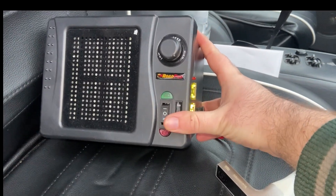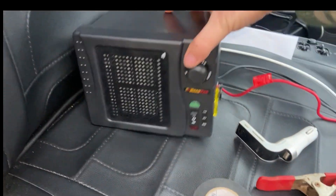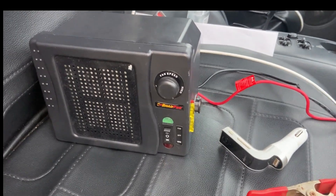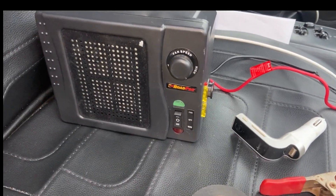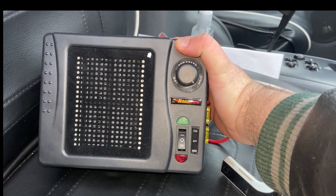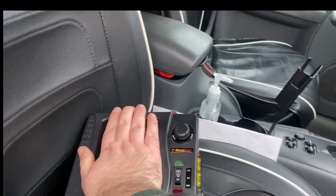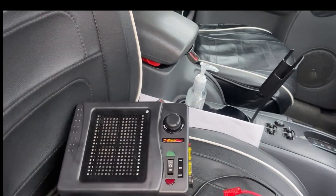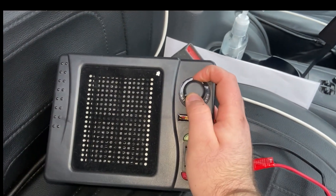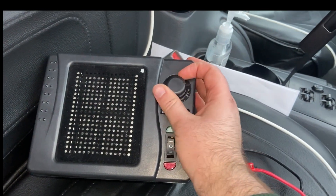This heater has a heat setting and a fan-only setting. It's hard to burn yourself on the front because it has felt, which is insulative and doesn't transfer heat into your hand the way metal would. This is a ceramic-based heater, so they're supposed to be self-regulating: if it's colder they draw more power, if it's warmer they draw less. If it were to get covered, its amperage is supposed to drop off and basically stop heating. That also allows it to have a variable fan speed, though best to keep it on high for maximum heat output.